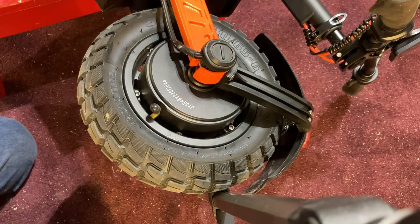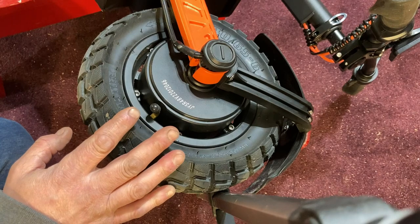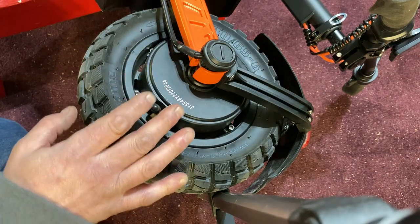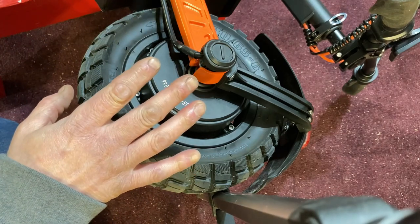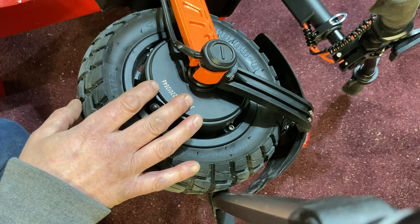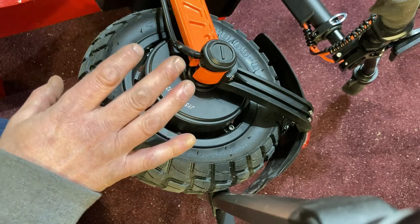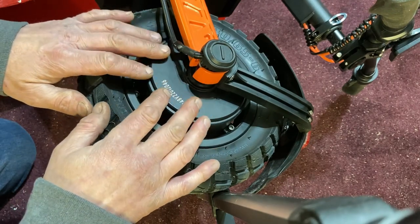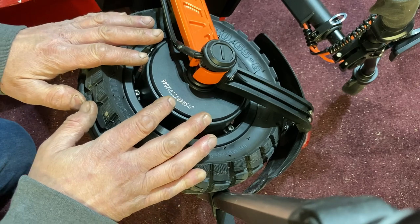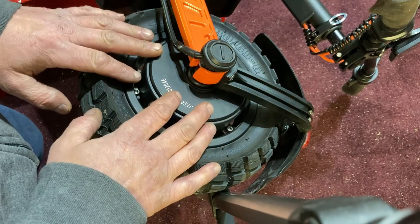Welcome back. This is the S5, but it's exactly the same for the S10s dual wheel drive. The only difference is you won't be playing with the brakes on the S10s because they're hydraulic and self-adjusting. You won't have an issue where you have to adjust the cable after doing this to make sure the wheels don't have a lot of drag on them.